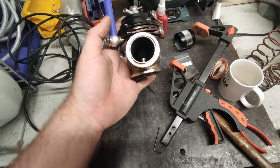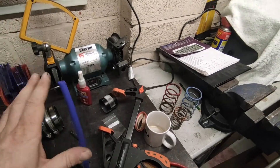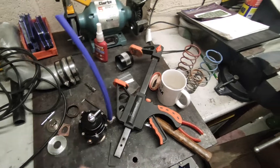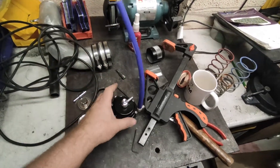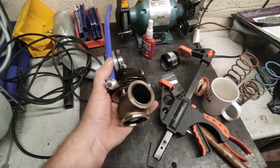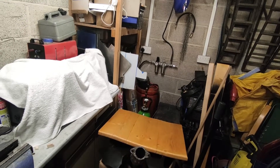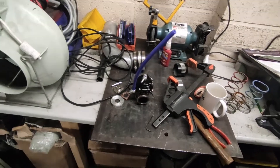Time to place your bets — that's all now in and fitted. I've just got a little regulator over on the airline. Now on the single spring, which is supposed to be a 7 psi spring, it was saying it was 10 psi before it cracked open. With the second spring in there — also supposed to be a 7 psi spring, meaning 14 psi crack pressure — according to the gauge, it cracks at 20 psi. So it has doubled what it said it would do. Do we think the springs are actually 7 psi? Who knows — it's only a cheap wastegate at the end of the day. Or do you reckon the regulator isn't quite right the way I've set it up? Place your bets — when this gets fitted, what boost do you think I'm going to get? It's going to be interesting to find out.